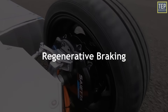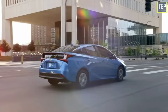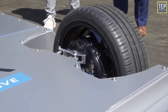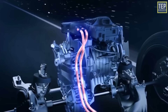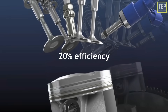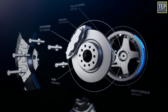Depending on the use case and driving cycle, some in-wheel motor designs offer regenerative braking as well, meaning the system captures kinetic energy while braking and sends it back to charge the battery. Some hybrids such as the Toyota Prius and Tesla Roadster already incorporate this regenerative braking technology, providing longer driving range. One of the greatest advantages of in-wheel electric motors is that power goes straight from the motor directly to the wheel. In city driving, an internal combustion engine may only run at 20% efficiency, whereas an in-wheel electric motor in the same environment is said to operate at about 90% efficiency.